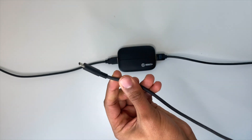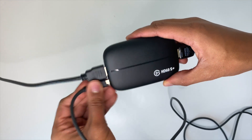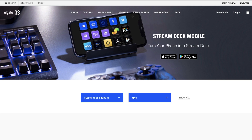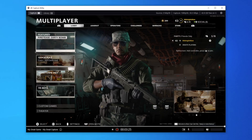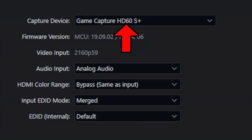After that, take the SuperSpeed USB-A to USB-C cable, plug the small USB-C end into the Elgato capture card, and then the other end into your computer. Once you've done that, go ahead and download the required software and drivers. If you're on Windows, download the 4K Capture Utility tool; if you're on macOS, download the Elgato Game Capture software. At this point you're ready to pull in your video feed — launch the Elgato software for whichever computer you're using, make sure you have the correct device selected, and you should be able to see a picture.